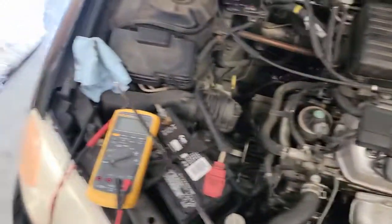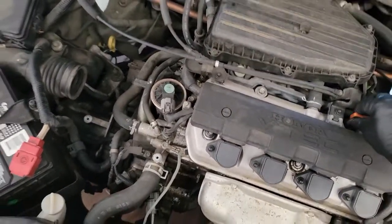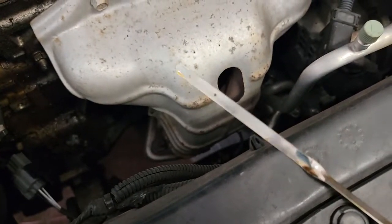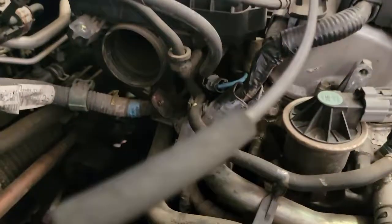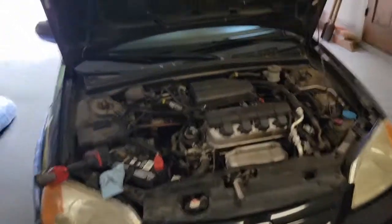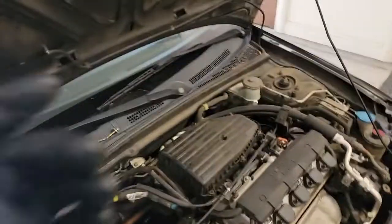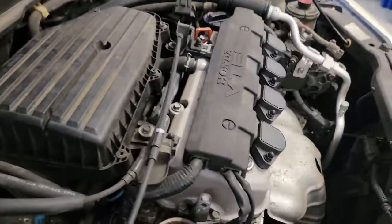One other thing I forgot to mention - the oil cannot be low, because if the oil is low you'll never build up enough oil pressure at the top of the engine. So I just checked it myself and it's not even on the stick. I think he's had this oil leak coming from this valve for so long he just let the oil get low. So I'm going to fill it up with oil and then retry it. It was almost three quarts low, so that's probably the issue - it probably only holds four quarts total anyway. I filled it up. I only had Mobil 1, hated to waste it in this thing, but that's what I had in the right viscosity.